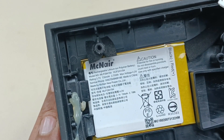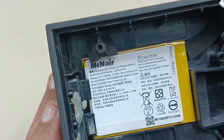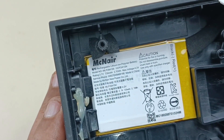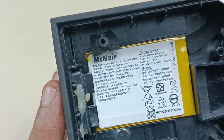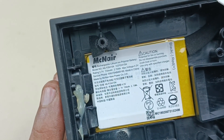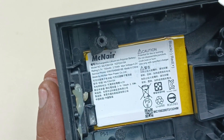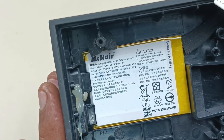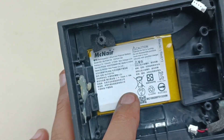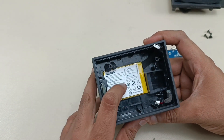The battery is a Mac Nair rechargeable lithium-ion polymer battery, model number MLP 284154. The rating is 3.7 volts, 730 mAh — a bit higher capacity compared to the JBL Go. Made by Mac Nair New Power Co. Limited. The label also includes a caution: potential for fire or burning — do not disassemble, puncture, crush, heat, or burn. Use only with the specified charger.